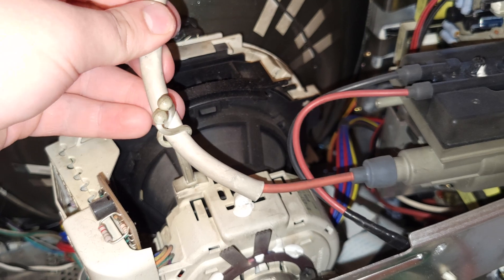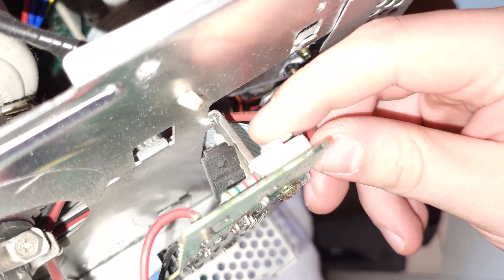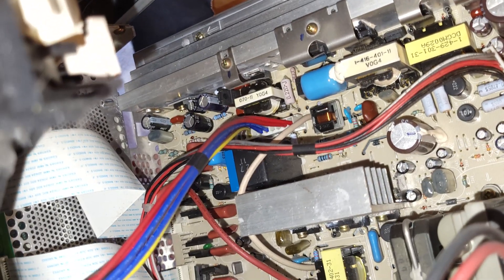It's very convenient. Then you've got these two little clips on the bottom, and this little clip on top of the yoke for the anode cap, plus some cables right here to remove as well. It's a little bit dusty — glad I cleaned this off. These little screws and cables — we gotta remove these screws because we want to get that deflection board out of the way to get in there more. We've got a shitload of cables all over this board, including ribbon cables, that little cable hiding behind the heat sink. It's a pain in the ass.